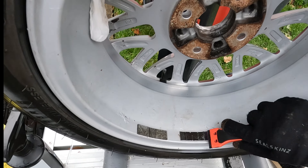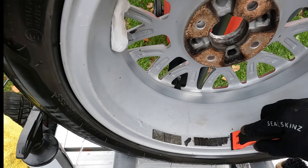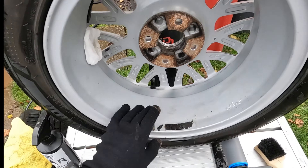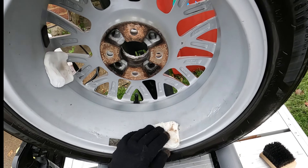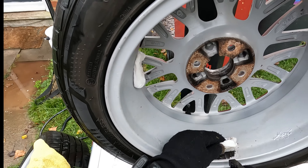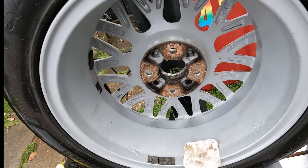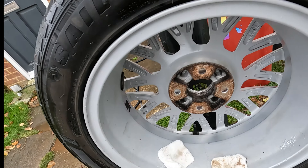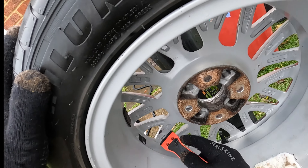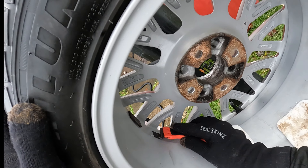Here's another little top tip — using a plastic razor blade to remove the adhesive after soaking. Use the angle at around 35 degrees, which is very safe to use. Don't go in at 90 and start digging away at the clear coat — no one wants to see that. Very, very light pressure — you're just trying to ease that away.